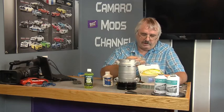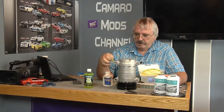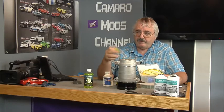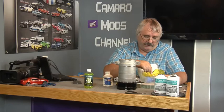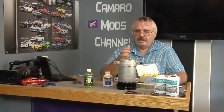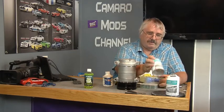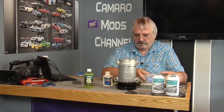It comes with a shot of dye that goes into your oil, put it in your compressor. It's for when you have a system that's already broke open. If you have a closed system that's maybe a little bit low on freon, you've got a leak, well, you probably want to have the dye in the pressurized can.